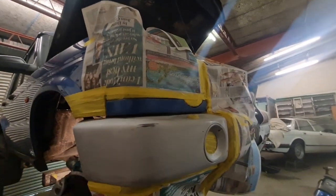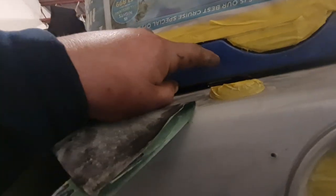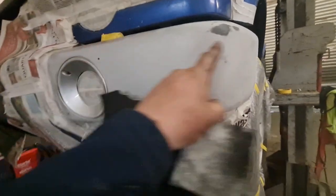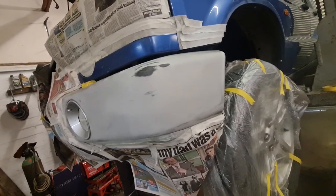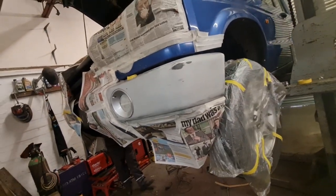The other thing that's been going on is masking off of these bumper end caps. We're going to do these hockey sticks as well because they've been painted in the past — they're quite orange-peely and there are loads of chips on them. So we're going to paint them and the bumpers. We've just smoothed off any scratches and the same on this side — taped up all the lights and everything. This was quite scratched here so that's all been smoothed off. We've got to order the paint; we haven't ordered it yet. So we'll order the paint, get them done, and get that arch welded in.